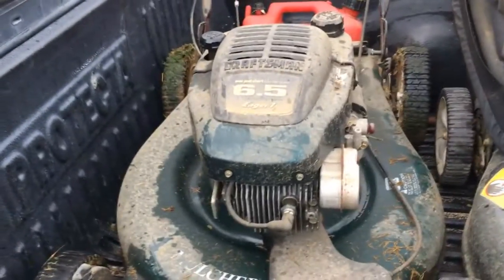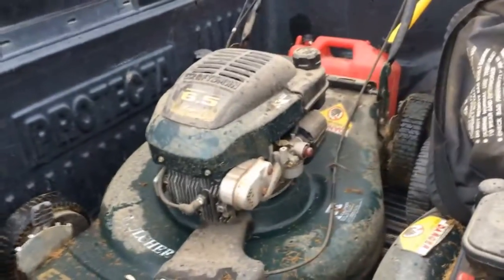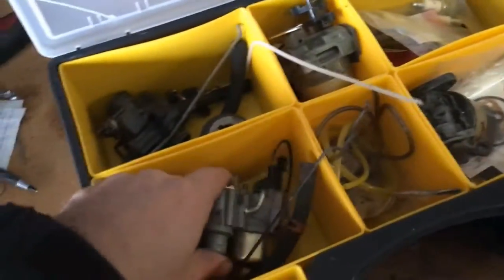What I'll actually do with this one is flip it over when I get it back to the house and see if I can rotate the blade, see if there's any oil in it. There's a mixture of old and new oil on this thing. I don't know if he tried to service this and put too much oil in — I have no idea. Not really too much of a fan of these Tecumseys. I've really kind of lost a lot of interest in fixing these up, but I do give them at least one chance to see if they decide to start up or not. I'll end up giving you guys an update on both of them. Probably get to this one first because it might be the easiest to deal with. I've got to go get a primer bulb out of my parts hoard. That is one of the primer bulbs — that's what we need. I went to Harbor Freight a while back and picked up one of these. Got all sorts of carburetors and small parts and spark plugs, diaphragms — I probably should bring this with me as well because I bet that lawnmower needs a new diaphragm in it.